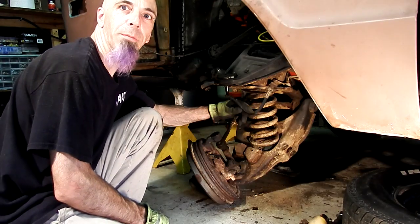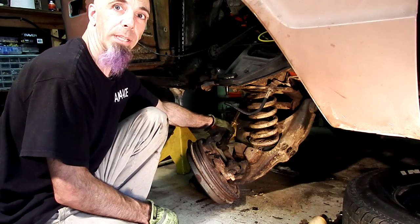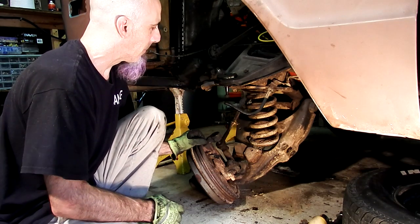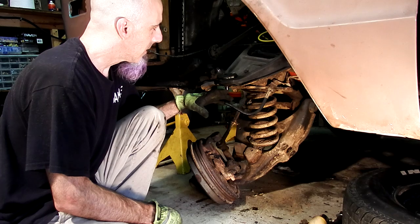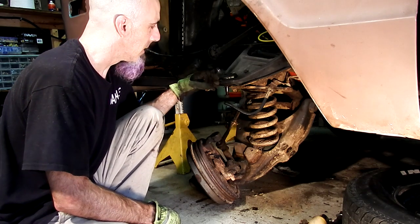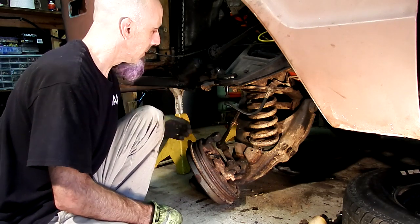So I think I'm definitely going to replace this brake line because it just snapped. Keep in mind when you're doing this you may need to take off your steering linkage and you may want to disconnect your brake line or figure something else out. It may have been a better idea to do the lower ball joint instead of the upper, because then that would have come down and left all this up. But this is kind of all in the way, so what's done is done - we'll go ahead and replace that.